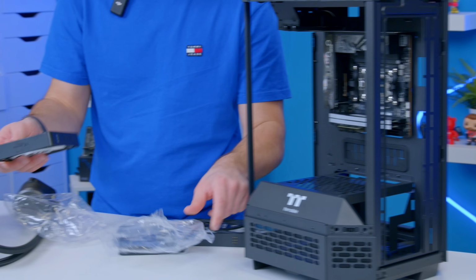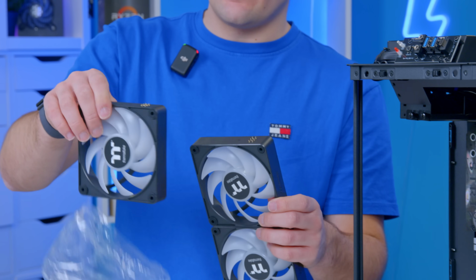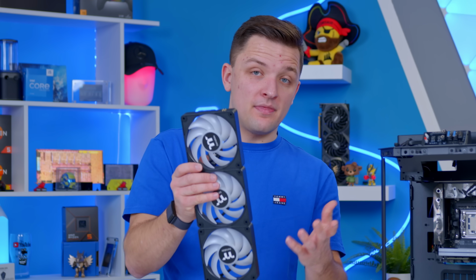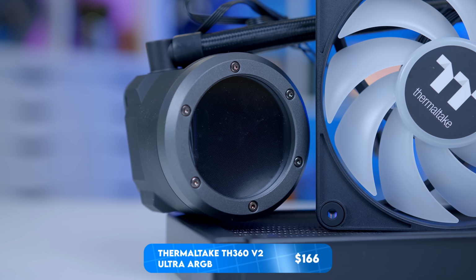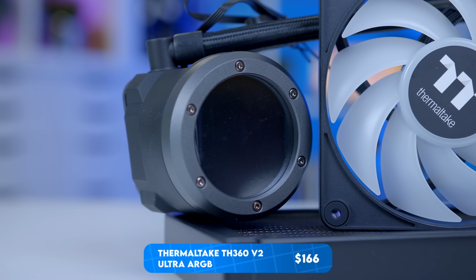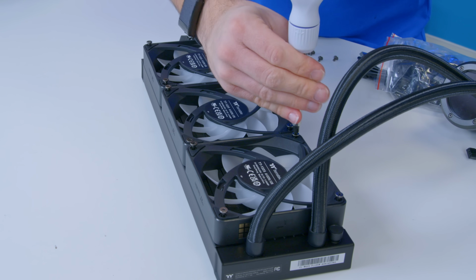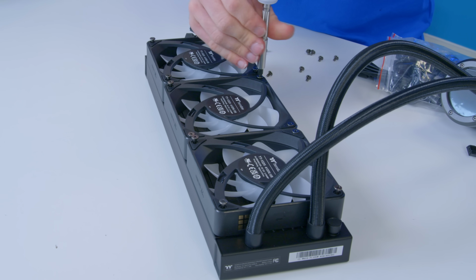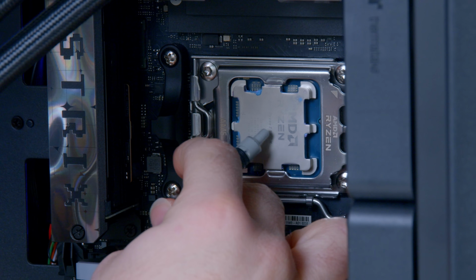These fans are really nice because they're magnetic, so all that happens is they just click together, and in a mini ITX build where you've not really got the space for cable management, that makes a big difference. The cooler I've gone for also has a screen on, so we can monitor those key CPU temperatures and see whether or not this configuration was smart after all. I'm going to begin by popping the fans onto the radiator outside of the case and getting the wire in sort of there or thereabouts, then dropping the radiator in, and finally finish off by installing the CPU water block.